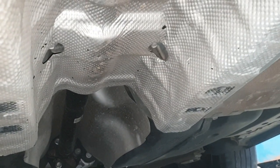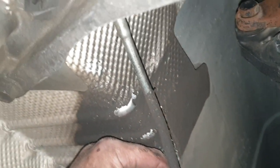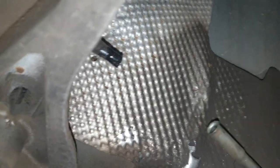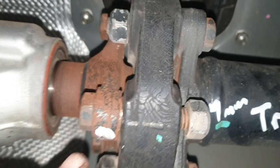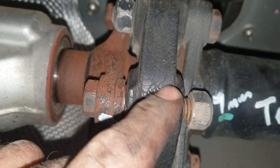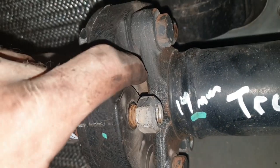Draw an arrow on the heat shroud so you know which way it goes. With that heat shroud removed, just be aware lots of stuff may fall down — you've got a breather tube extension which just slides off. I like to disconnect the rubber donut from the yoke so that way when you've got it out on the floor you can change it if you have to. Just inspect the condition and make sure it's not perished. You need a 19mm spanner and an 18mm — they're pretty simple.